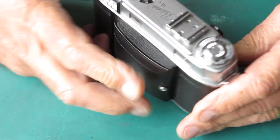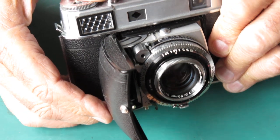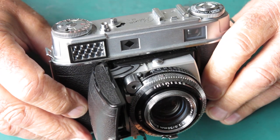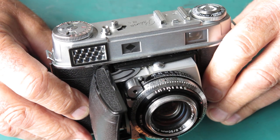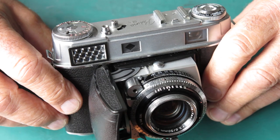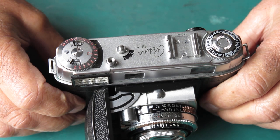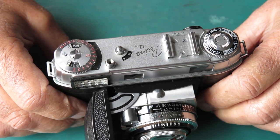The shutter release is out of adjustment. When you press the shutter partway down, it releases the film advance so you can wind on to another shot. In practice, if you're lining up an action shot and press the shutter release slowly, then change your mind and let your finger back off, you pick the camera up again and check if the shutter's cocked by swinging the film advance lever. The lever will swing, but that means there was a blank frame of film that never got exposed - so you'll end up with blank shots on your film.